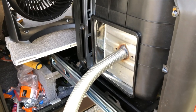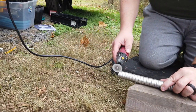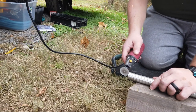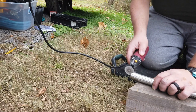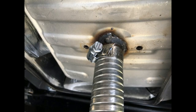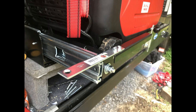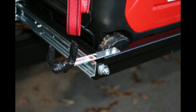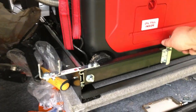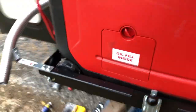For the exhaust, I got some cheap one-inch flex tube from O'Reilly's, but it was too rigid to tighten down, so I needed a better mounting solution. I tried electrical conduit with a compression fitting but wanted something more firm. I took a cutoff wheel and put about one-and-a-half centimeter slots in the end of a pipe to get a hose fitting to clamp over it - that worked great. But when I started it up it still wasn't rigid enough to stay in place, so I went to the local hardware store, found some aluminum and L-brackets, and made a support bracket. Wrapped it with electrical tape to stop the rattle. During testing it slipped out once, so I may add a silicone strap over the top, but I think it'll be fine.